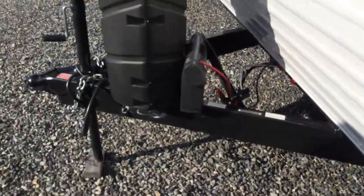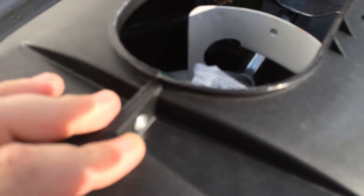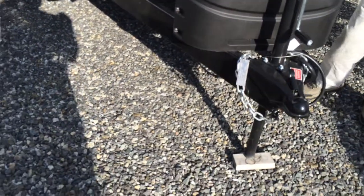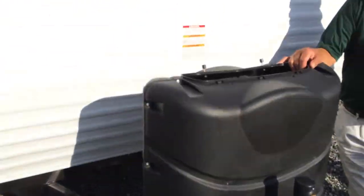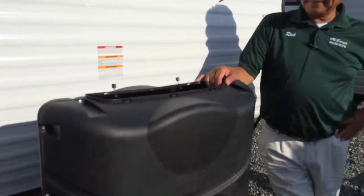Where is the battery stored? We'll put a battery right here, in this tray. So a new battery will go there. Correct. And then we'll fill these tanks, and he'll go over how you actually do it. You turn both of them on, and this regulates it. When one goes out, the other takes over. So what will that power for me? That powers the water heater, your stove, and your refrigerator. So we can run the refrigerator off of that too? Yes.